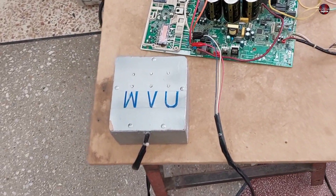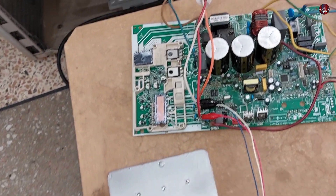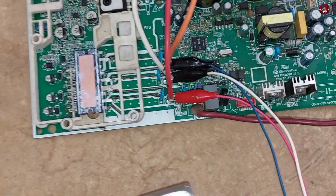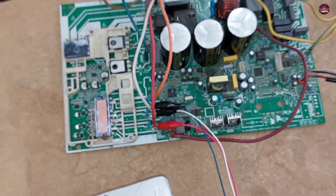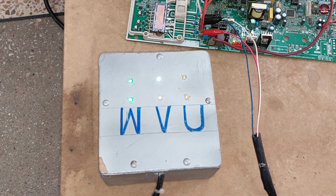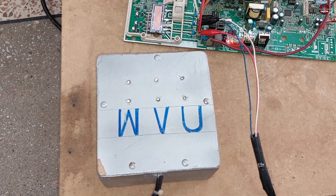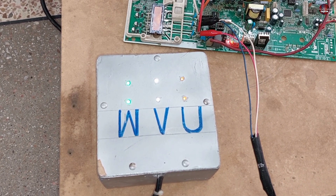Now I have installed the UVW analyzer on with the PCB. I will check it with two methods. I have installed the analyzer wires on the control board with the compressor wires to determine whether the compressor is faulty or the PCB is faulty — the analyzer plays a great role here. All the IGBTs have turned on but the compressor is not starting. The control has turned off the IGBT, it is not showing any error now. Again it turned on the IGBT and turned it off again.